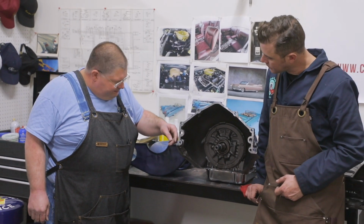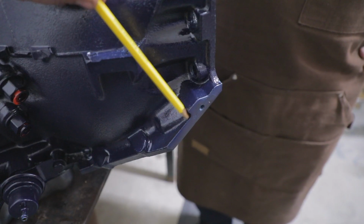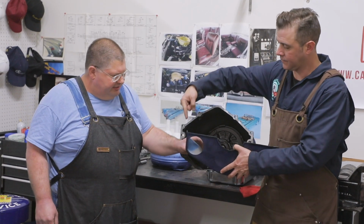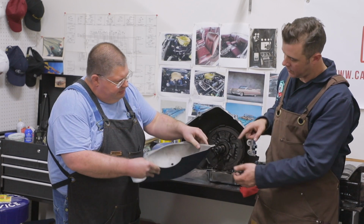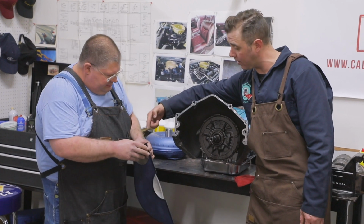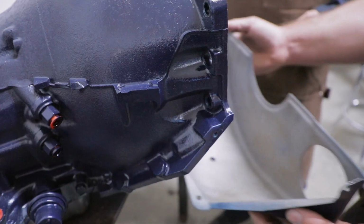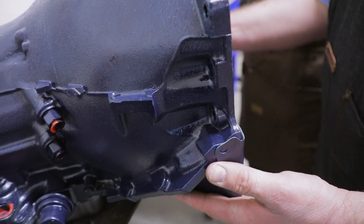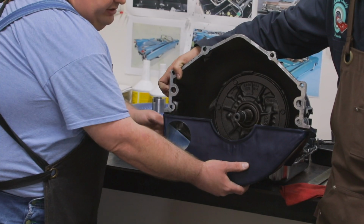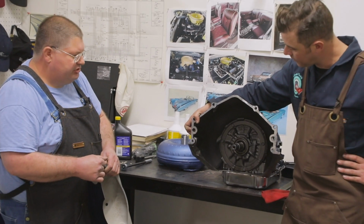So I came in about where the screw hole for the cover plate normally went. And I just cut straight down the side. And then I took the cover plate, and both sides were like this. And now this hole is missing where it mounts. So I bent the tab up and drilled and tapped a hole in the side of the housing. So now this all fits nice and lines up and looks really good. So that's one little modification that you might have to work out depending on what engine you're using.